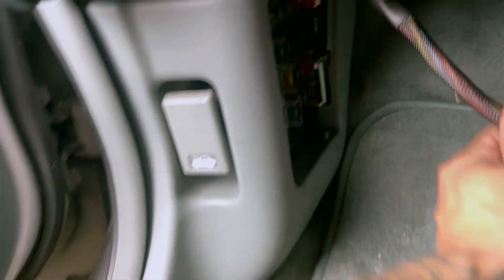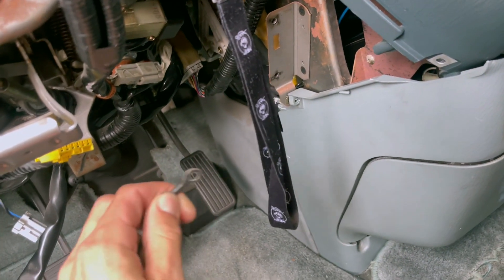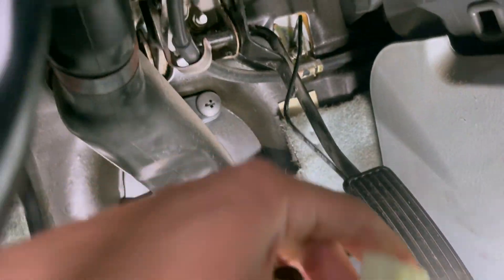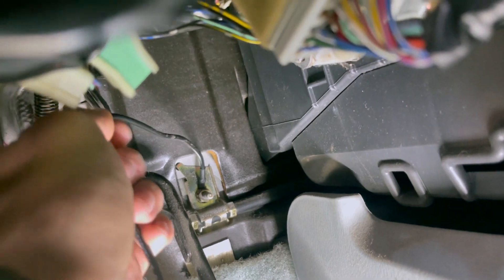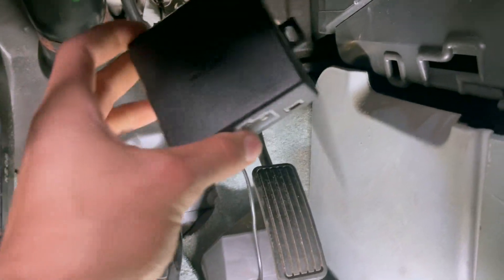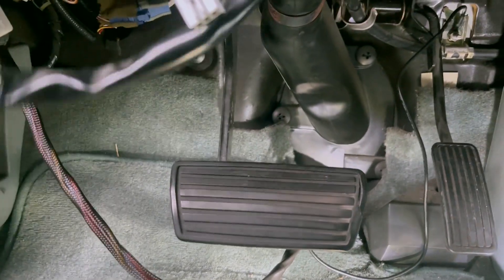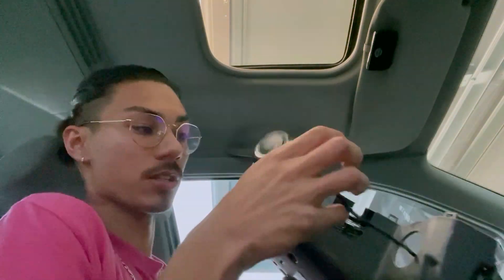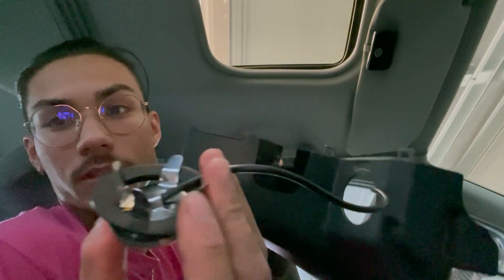I got the OEM harness out here — it's all routed up right here. Here's what we're looking like: there's the JDI harness, and now attached to that JDI harness is going to be this, and we're going to use this for a ground anywhere you can find a screw — it doesn't matter, it just has to be by itself in order for it to work. Here's the harness and here is the ground wire. That's where I grounded it. This box right here by JDI — most of this stuff plugs straight into this box. This white one will go right here. I have my piece where the original ignition would be right here — just feed that wire through, and if you need to you can bend the tabs. You want to make sure the tabs go on the back of this panel and then once it's all behind the panel you can bend them to secure it.